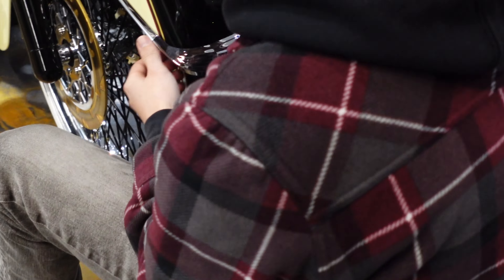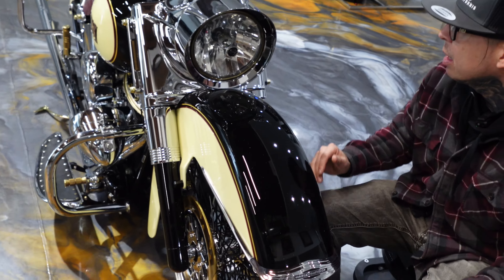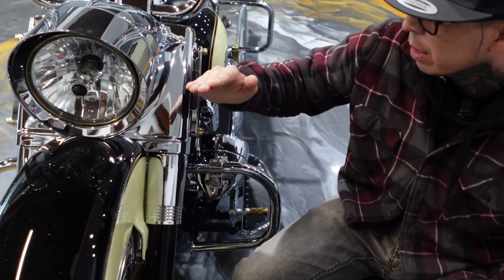It came out pretty cool, I'm happy with it — it needs a little bit of finessing. And then you can see right here, beforehand this nacelle used to point a little bit too high. It was fitting really nice over the fender and everything, but with the 26 and the rake of the trees, the OEM nacelle we made fit — the degree was way too high, so it was kind of pointing up. Eddie used to make fun of it all the time. So we did a custom nacelle where we angled it down and cut it to make it all work. It really gets the flow of the bike spot-on.